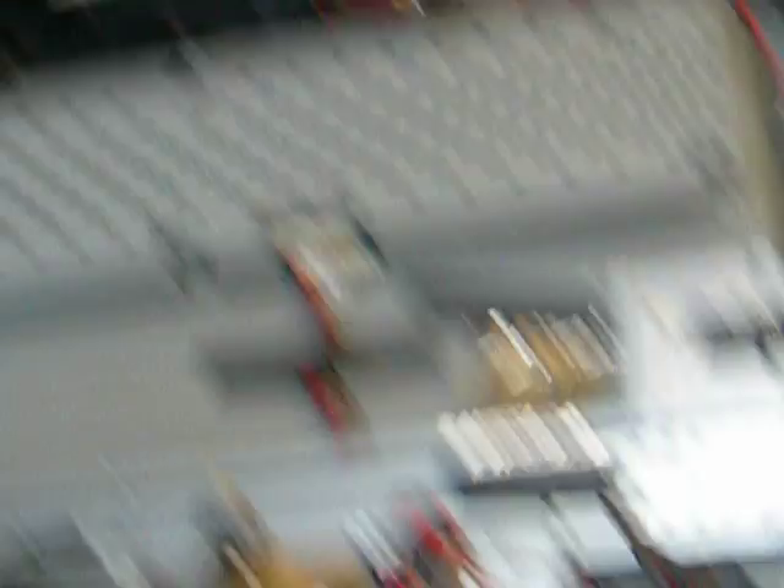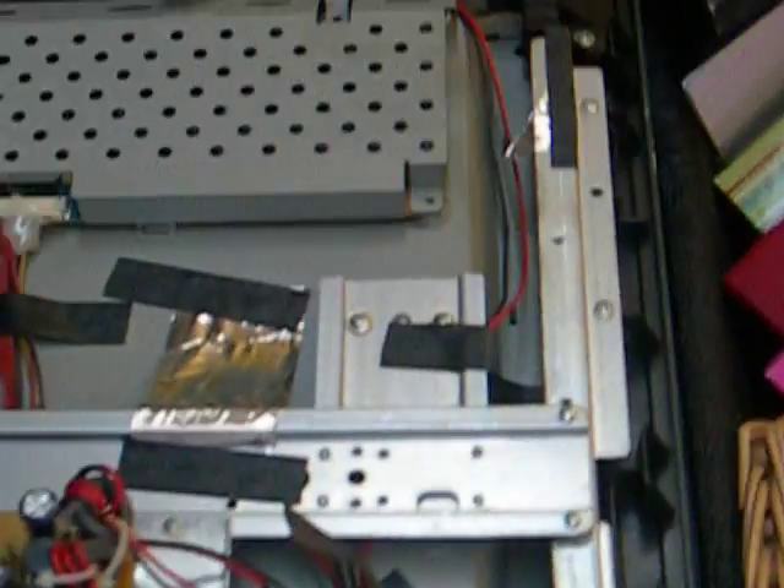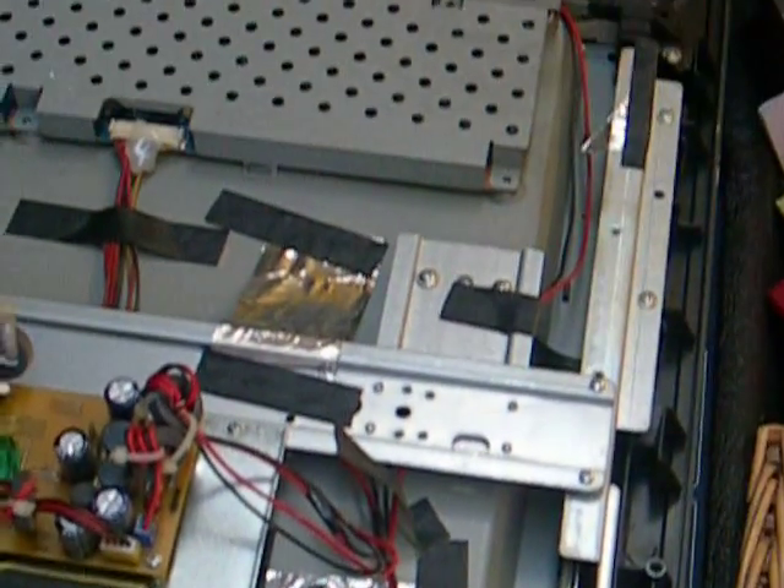You can see how hot the backlight has got because it's actually browned there — really significant browning due to the heat. You can actually see where the air has flowed through it. The worst browning is at the top, so it's not surprising that one of the top transformers has failed, because obviously that area gets the hottest as heat flows upwards. I'm not sure what the failure mode is exactly — it's due to winding arcing in some way. I'm not sure if heat accelerates it, maybe it degrades the glue or the varnish. I can't be certain, but anyway it should be interesting to repair.